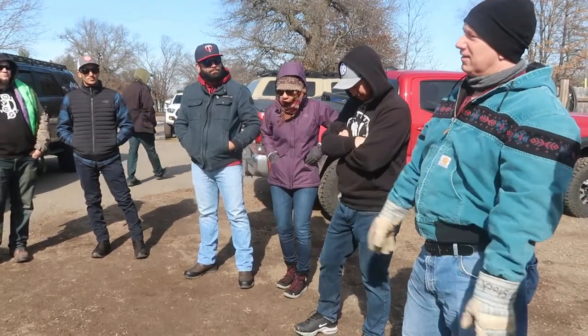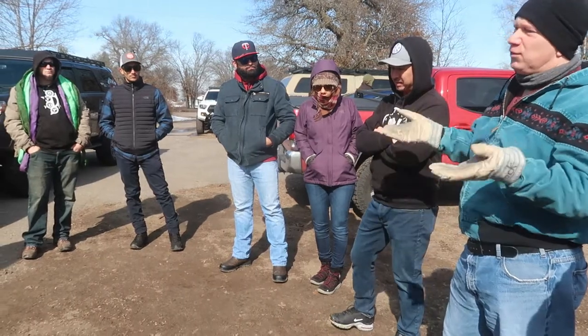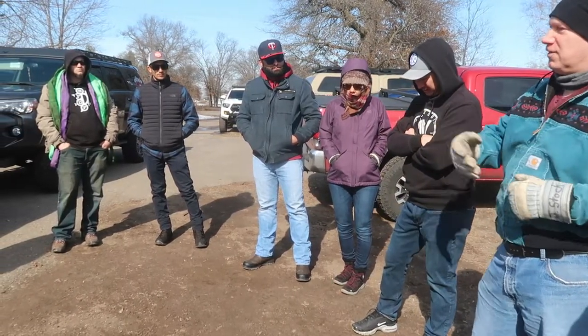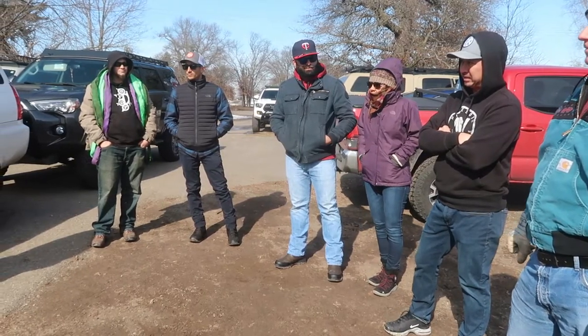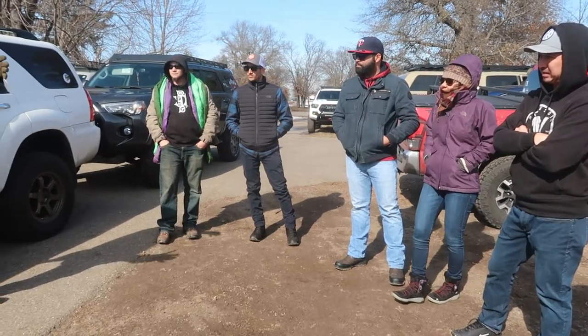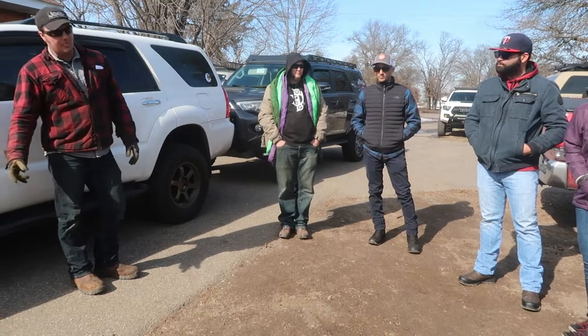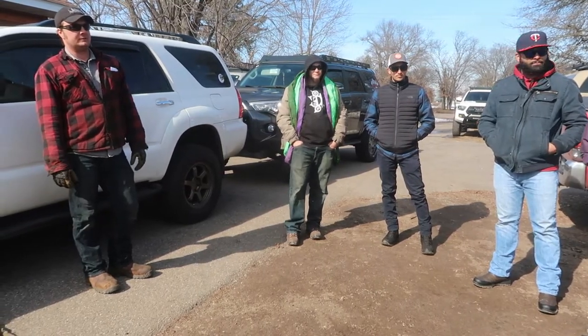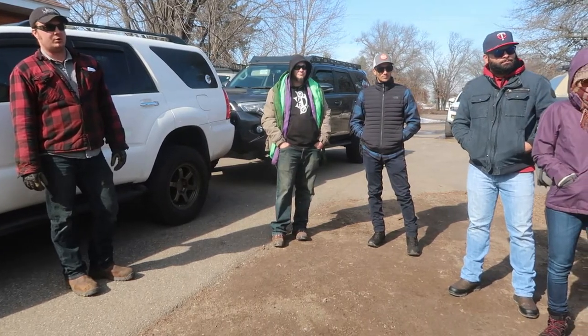I'm just not thinking winch anchor because they're like $500. Like, what do people think? I already have two sets of sand ladders. I have a winch. You got a spare tire and a high lift? Yes. You got a shovel? Yes. If you're in the desert and off sand, soft sand, dig a trench, bury that tire, put the high lift behind it. Make a dead man. Yep. And then just run a strap. Because I can't justify a $400 winch anchor.